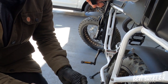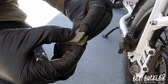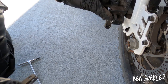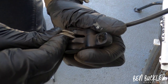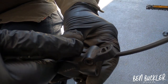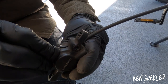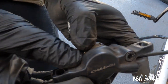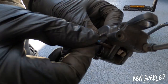When you are putting new brake pads in, it's useful to also put in this new wishbone spring thing — there's probably a better technical term for it, it's like a little bracket. Line it up on both sides, squeeze it, and slip it in. It can be a little bit fiddly, so you just need to have a bit of patience, take your time, and have the right angle. Once they're in, go back to the top and put the bolt back in.